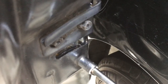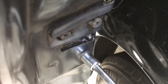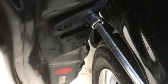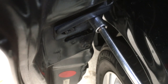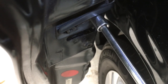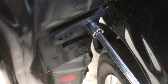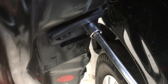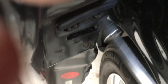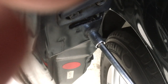Don't forget these three bolts back here at the latch. They are all the same size so just get them in and get them snugged up. A great tip from Eric the Car Guy is to use quarter-inch tools and grip it close to the head of the ratchet, because it is very easy to over-torque these and strip them right out. You are going to feel them get tight and it will take some muscle to snug them up, but you won't over-do it and strip them out.